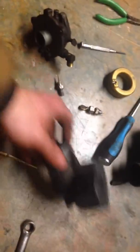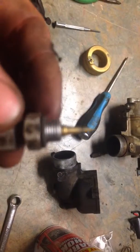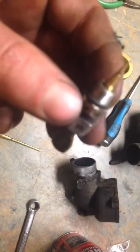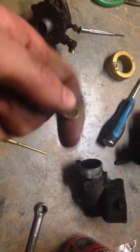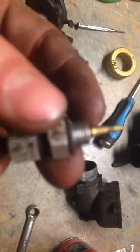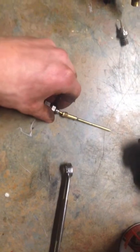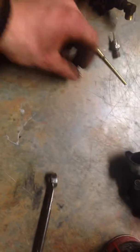So I found a problem here, and this is actually probably my fault. What probably happened is I took this jet out and forgot to turn it out all the way. Whenever you reinstall one of these jets you have to turn this needle out all the way. What happened was it turned down and pushed in real hard — I wrenched this right down tight inside the jet. So when it did that it caused a little taper.